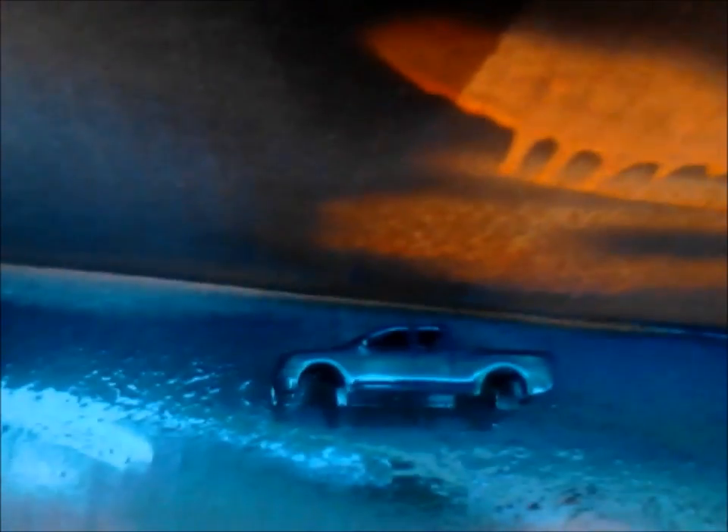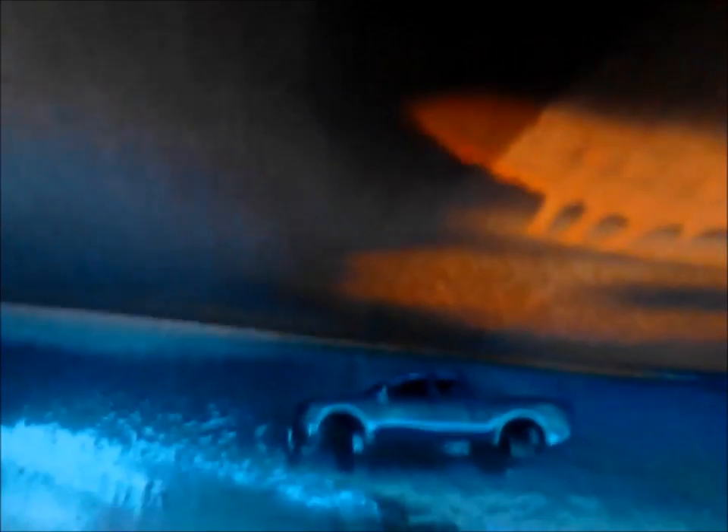Here it is drying. What I found was you don't really get a nice cover when you do the sides. What you should do is spray it close — get your can about here so the spray is pretty close, and go over with your overspray to get full coverage. Unfortunately, you'll get your smoothest coating on your roof, hood, and trunk area.